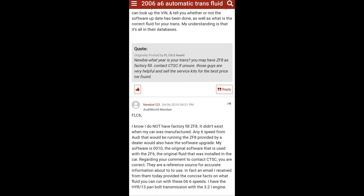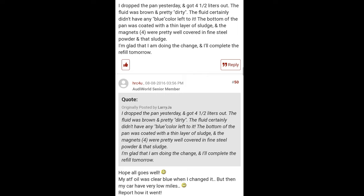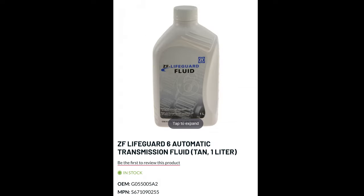A big hassle. I don't have time for that, and I need to get this car back on the road within a few days while I wait for the other fluid to come because I'm in the middle of a move. So I would recommend pausing and reading through all these really quick. My suggestion is if you pull out a blue color fluid, I would put that color back in. If you pull out a tan color fluid, put that color back in. I wouldn't advise mixing the two, and I definitely wouldn't try to do the flush and the software update yourself. I've heard the software update sometimes doesn't even work. So I left a link below to everything that I found. And there's a link below to the ZF Lifeguard 6 fluid in case you need that as well.